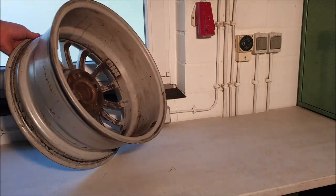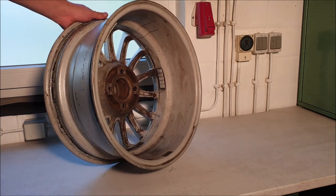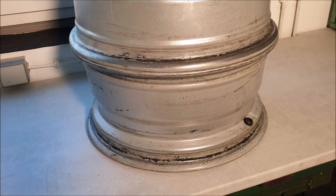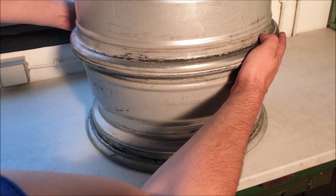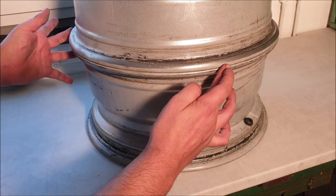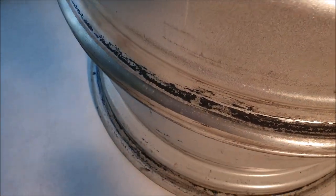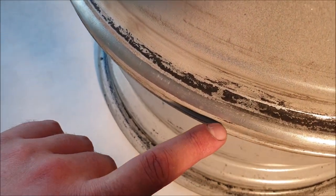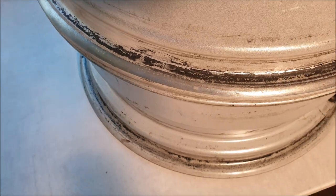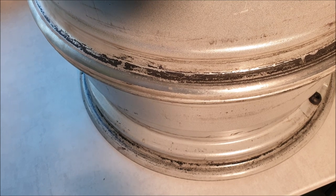The second thing is you should check if it's still round. If you can see that it's not round, I would refuse to buy it, because it's a difficult repair. Here is another trick I use when buying used aluminium wheels: I put two together and try to lay them exactly in the same place to find out if they are still the same. As you can see at this one, it's not the same here — this one had contact with a curb stone or something like that. So I personally would not buy it, because it's a difficult repair and in some cases it cannot be repaired. Even if you get them very cheap, the repair is quite expensive.